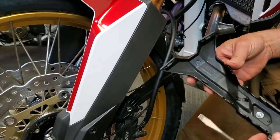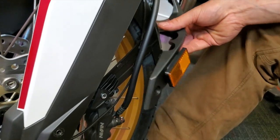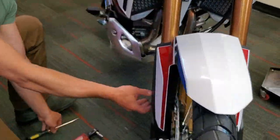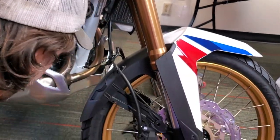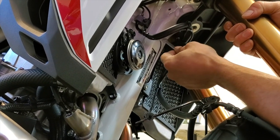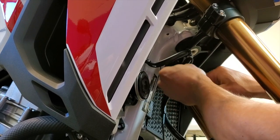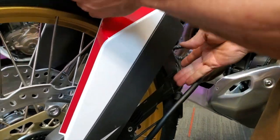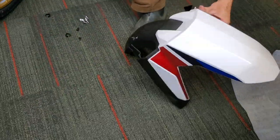Just the brake line on the other side. It can be nice to use a flat blade to go ahead and get that first clip initiated, because it feels a little intimidating and you don't want to break it. That clip is what's retaining it. The upper brake bracket — because it's a tight fit between the lower triple tree and the frame — grab a spanner as it might be Loctited, and walk that off. Here's the rubber bung that's holding the ABS line in the fender, and now we should be free to remove our fender. Bring those rear struts together and wrap it in the foam that you received.